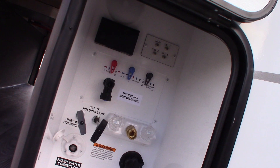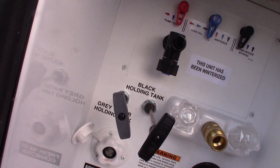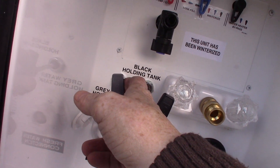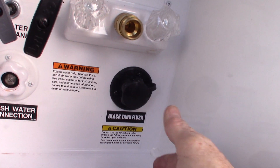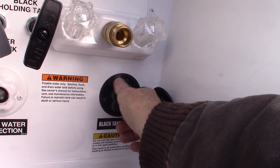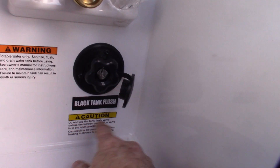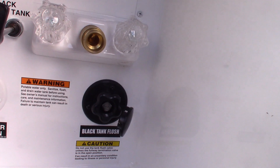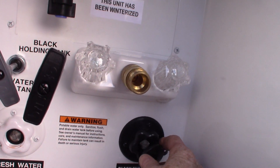This is your water dock. You have your gray tank and your black tank. Black tank is toilet water and waste; gray tank is sink and shower water. You have a black tank flush here — after you dump your black tank, you can hook up a hose at the dump station right here. Make sure your black tank valve is open, then turn it on and it'll flush out the inside of your tank and clean off the sensors.